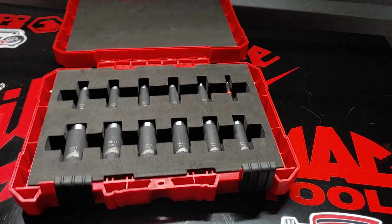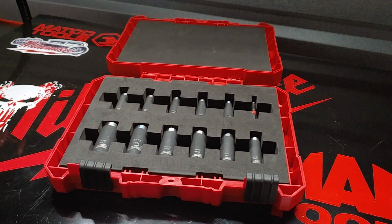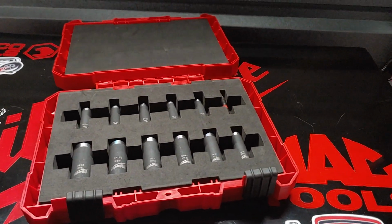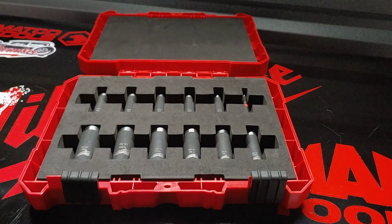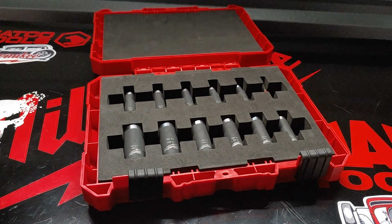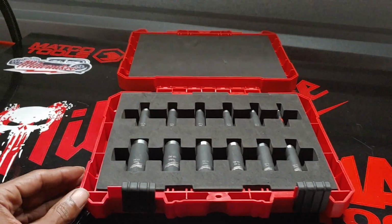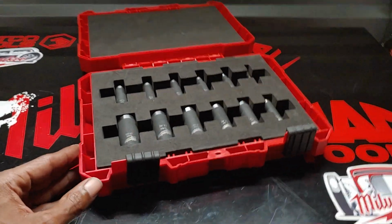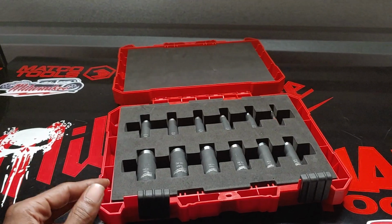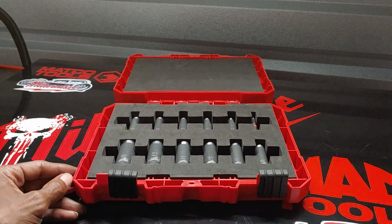I do have a large selection of impact sockets, ranging from Tekton to Gray Pneumatic, Sunex, Snap-on, Mac, Craftsman, and GearWrench as well, especially when it comes to 1/4 inch drive. But the issue is that a lot of those brands, whether off brand or tool truck brand, don't necessarily provide thin wall sets. Most of the impact sockets are typically thick.